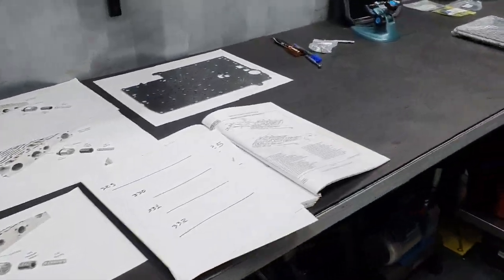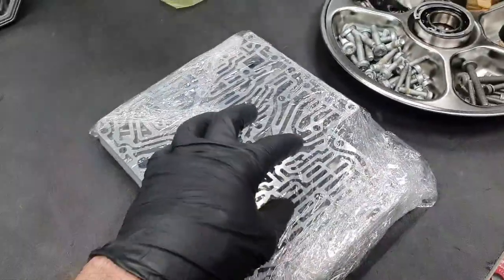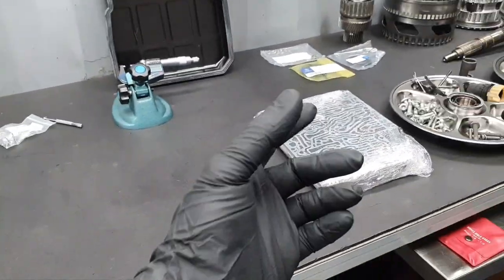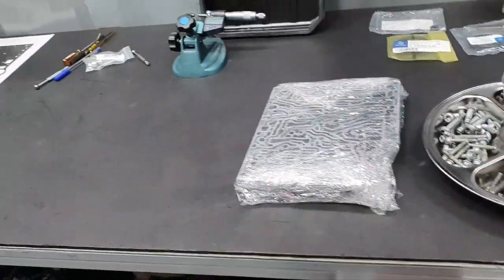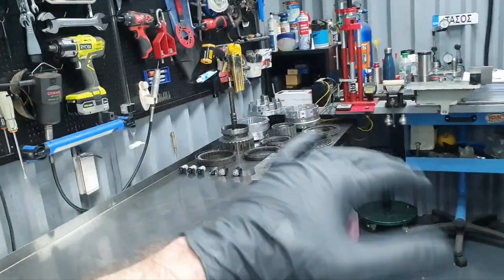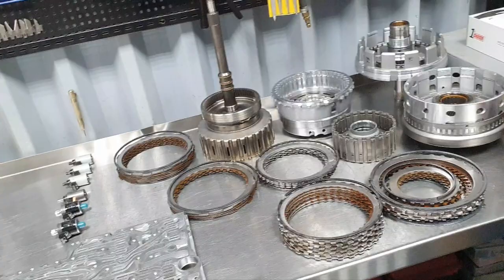Okay, clutches, solenoids, like I said, need to be checked. We are okay here. I wrap it already. I have it ready. It's beautiful, nice and clean. Completely dry, carefully inside the solenoids, like any other time. Before I close it, I'm putting a little bit of transmission fluid with the syringe, so when it starts running, it doesn't run dry. We don't have any headache. Nothing more, nothing less. Tomorrow, let's see what I'm gonna receive. I hope that I'm gonna see the clutches at least, to continue with the drums, to check the clearance, to verify that's correct, the thickness and the clearance.